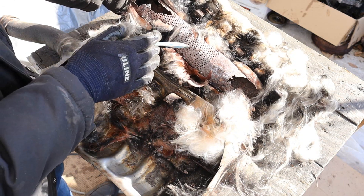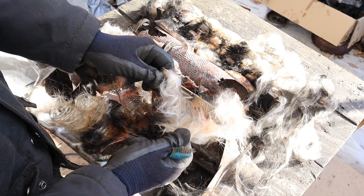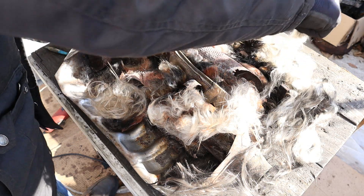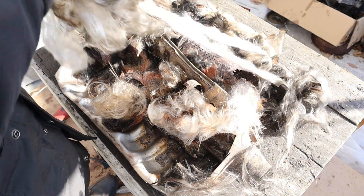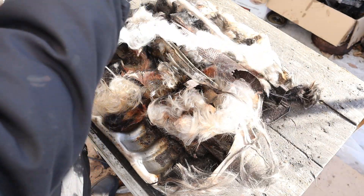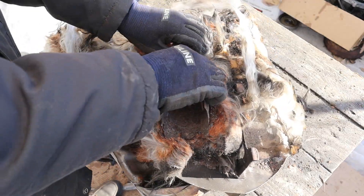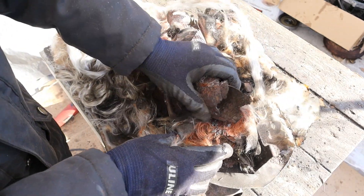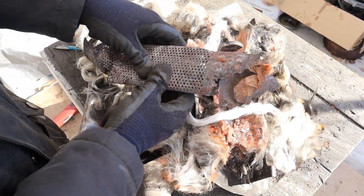When some of the sound and exhaust gases escape through the honeycomb, these pulses are going to be absorbed by the glass fiber material because it's really good at vibrating at those frequencies and canceling them out. It's made as one long piece of fiber. You can see this muffler was crumbling — it was rotten. Eventually some of this stuff could probably restrict your exhaust flow if it completely rots away. This car had 300,000 kilometers on it, so this is to be expected.